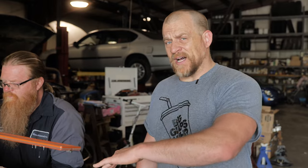But okay, so it's fixed. That's good. Sorry guys, didn't get to show it. Danner's got a shop to run and it doesn't revolve around us, so I apologize that we could not show you the after O2. In particular, I was interested in after it sits 15 minutes on a hot soak, started up. I wanted to see that bias line drop down very, very quickly, and we saw it hanging up there.